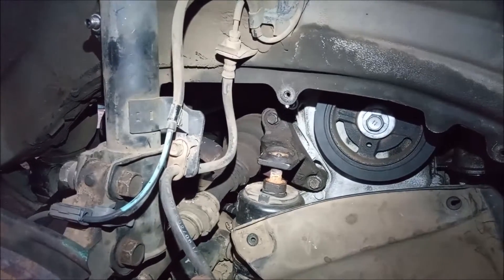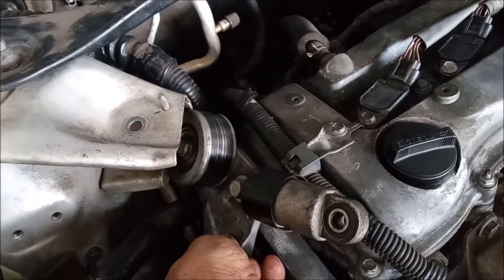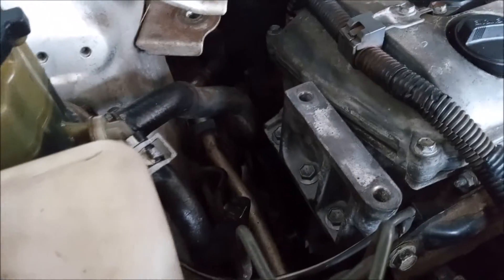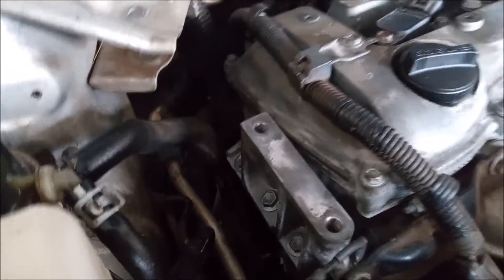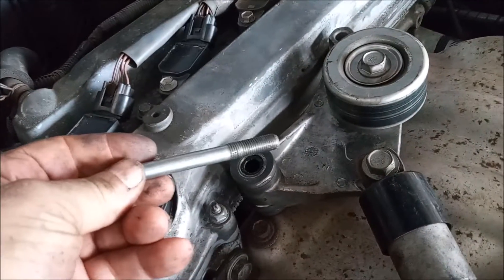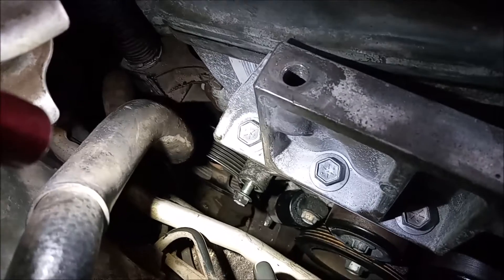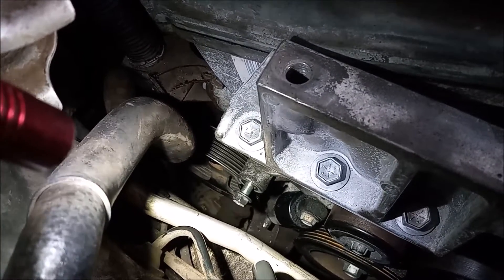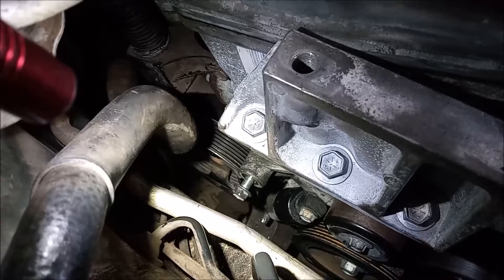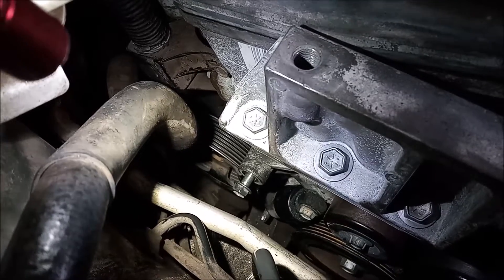Not much higher than that, because then it might become difficult to get it back on. When I do this, the tensioner and the mounting bolts wiggle right out through the gap. But if I did not lift up the engine, then it would be impossible for this long bolt to clear. Installation is the reverse of removal. You can see here how I've started the mounting bolt and I've got the end of the damper strut onto the stud at the bottom. Then I can just drop the engine back down and finish putting everything back together.